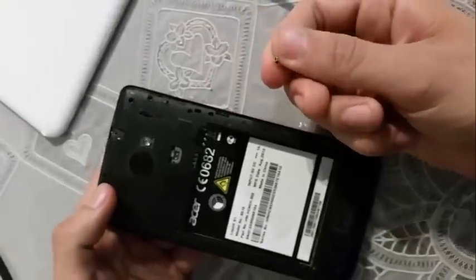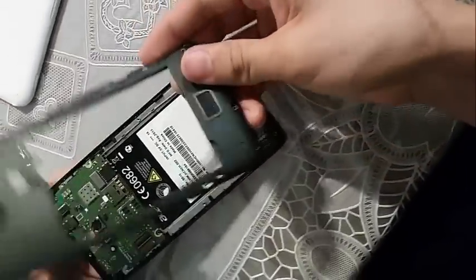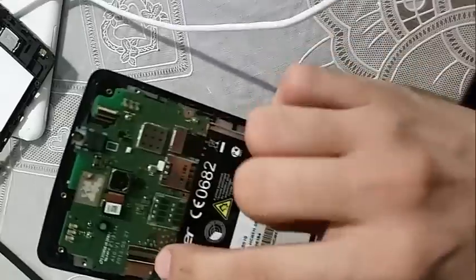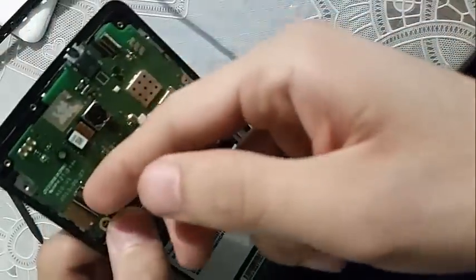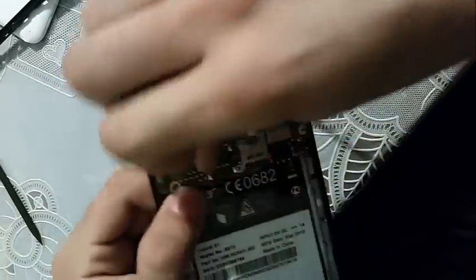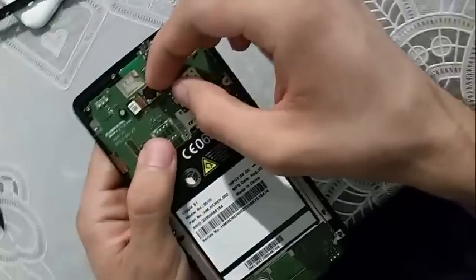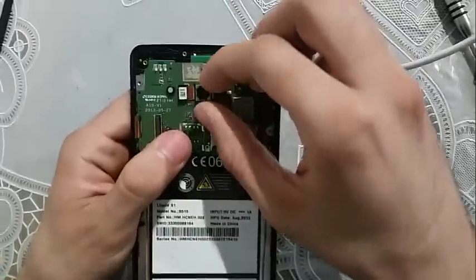I already done that. When you open the screws you just open the back cover, remove the back cover, and then you have the LCD cable over here. You disconnect it like so.